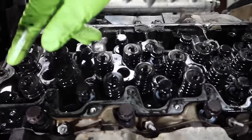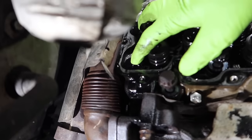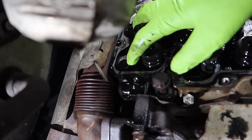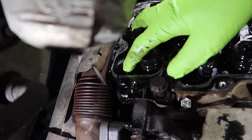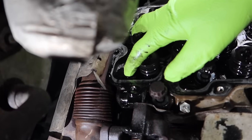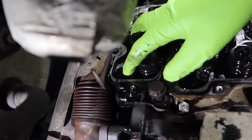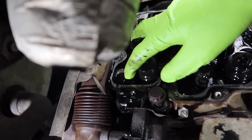Back two then, you're not going to probably, well, maybe you can see in these back two back here, you're going to have to go and get with an actual ratchet. These will be the last two. Usually with the socket that we end up using, it's not all the way deep well, but it's not a shallow either. It's kind of a mid-length. Use that with like a 1-inch bump extension and the ratchet. Generally, you can get them off depending on whose socket you're using and that sort of thing.